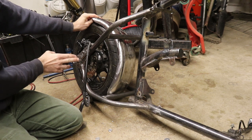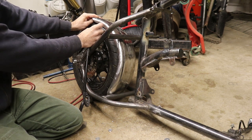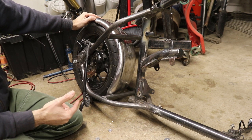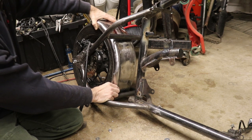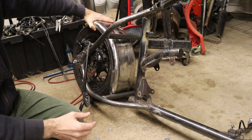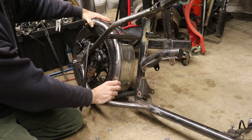The one thing I'm not sure about is adjustability. Because this is a hard tail, we're mounting the fender essentially to the frame, while the wheel's axle adjuster can move — which will increase or decrease the gap between tire and fender. It'd be nice to have some adjustment ability on the fender mounts themselves so I could move this thing in and out. I haven't quite figured out how I want to do that, but that'll be a different video.